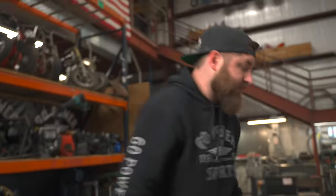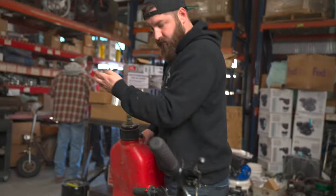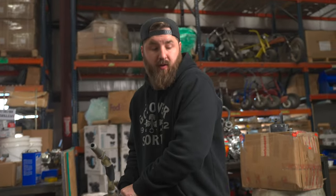Alright, now we've cleaned the carburetor, the tank's empty, and we've got our air filter ready to go. So this bike's been sitting for a while, and we're going to go ahead and change the oil in it. To change the oil the best way is to make sure the engine is warm so that all the contaminants and everything flow out nice and easy. Let's go ahead and put some gas in the tank. Around here we just use regular gas, but if you can get a hold of non-ethanol, that's the best way — in some parts of the country it's easier than others to get. The non-ethanol is going to help the shelf life and keep the carburetor from gunking up as fast. It still happens — nothing's perfect. I haven't found anything to be 100% other than just using it or cleaning it out before you let it sit.